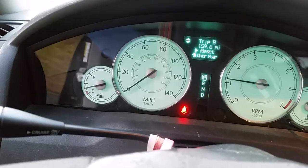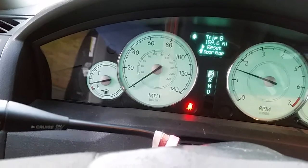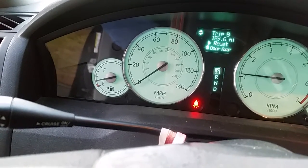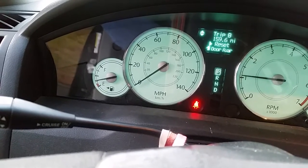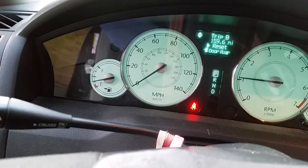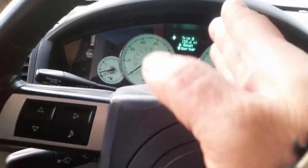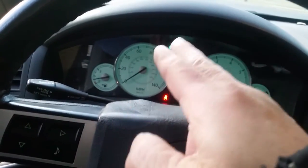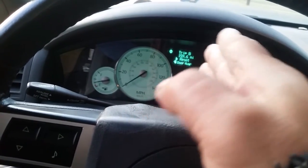Let's give it a little rev. This one only has 62,000 to 65,000 miles. Some of you guys have more than 100,000 miles on it, so it's carboned up pretty good. But you take the time, clean the butterflies in there. One of the main tricks I did was to take a screwdriver and turn the shaft back — open it up more than it's supposed to — only to get the rest of the carbon that's stuck in there. Flaps just go this way and that way, but if you go a little bit more, sometimes you knock a little bit of the dirt out, so when it goes back, it's a little more free.